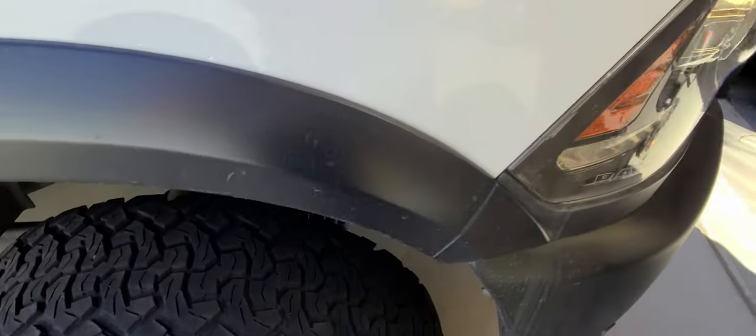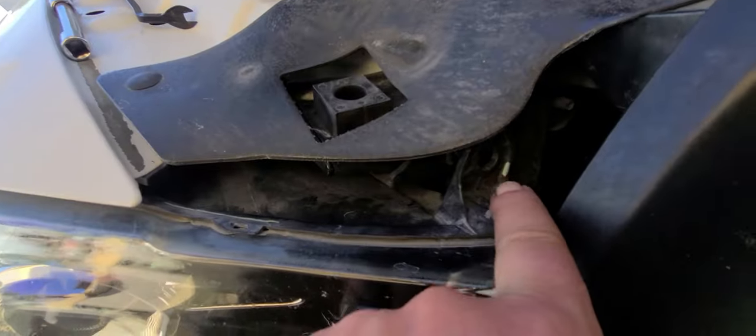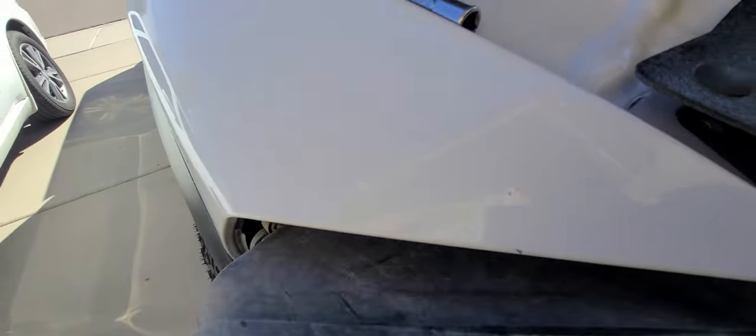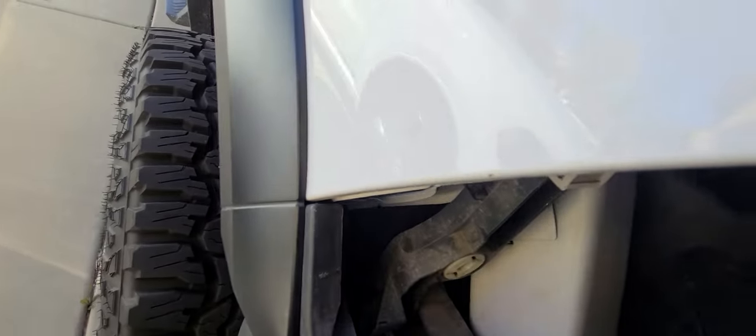It's loose now but something's catching, so I'm not gonna yank on it. I found a little trap door back here — when you loosen that up, I'm gonna show you what we're actually reaching for. This right here is a keeper for the back of the headlight that just slides up and down. If you push it up, that releases the headlight; pull it down and it tightens up and holds the headlight in place. Once you've removed the bolt up here and the one straight down there, grab the back and pull out — it will pop loose. This side comes out, which allows that tab that's stuck behind the grill to be free. There's a little nub that goes in right here and that's what holds the pressure in. But once you can move it, it slides out and gives you room to get that past the grill.